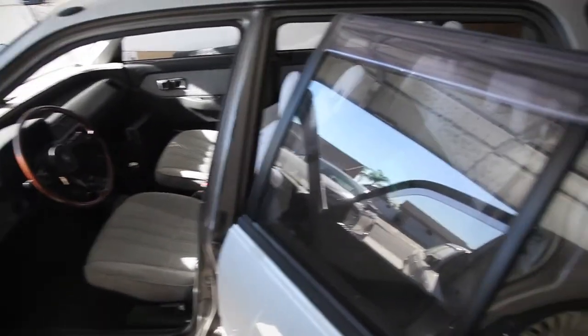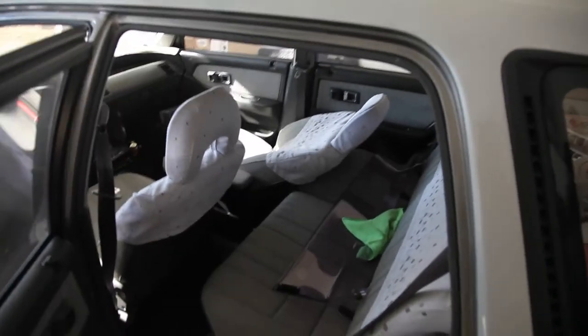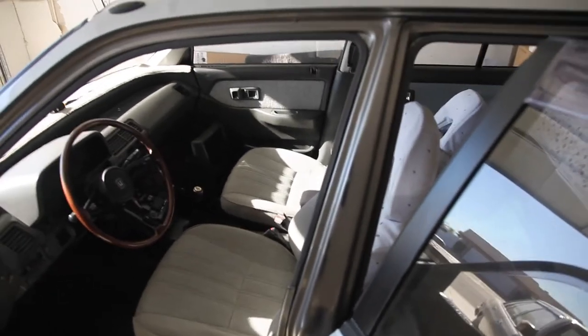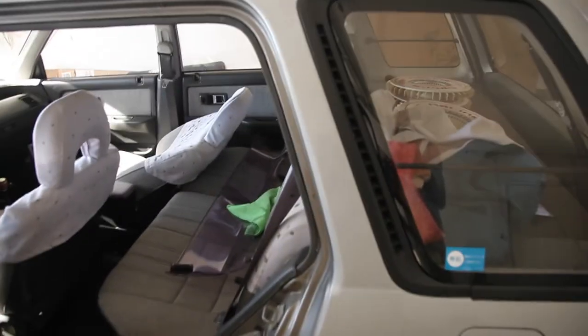So first step, I have the e-brake cables, and we're going to need to get to where they're at, which is underneath the center armrest or e-brake. So we're going to have to remove the seat first, get to those cables, trace them underneath the car, and pop them out.